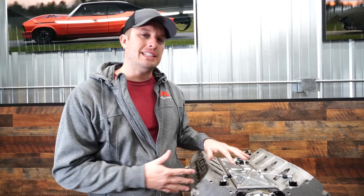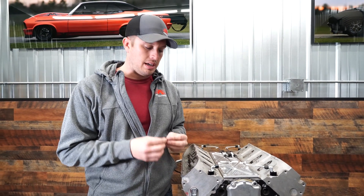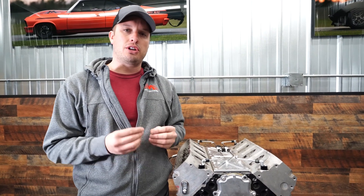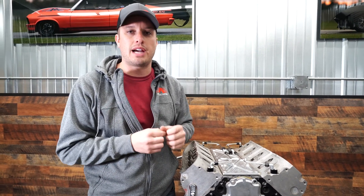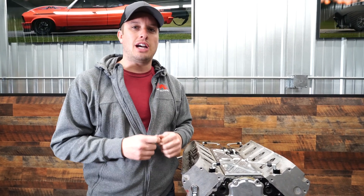After a year of making these, I've seen guys who didn't have them push them out on a very regular basis. There are videos all over the internet — you'll see the water dump, the car goes sideways and into the wall. Hopefully they save it; some do, some don't. But we get the call the next week — 'I wish I would have had those.' I would rather see you weld it, do it yourself, come up with your own mechanism. Just understand there's a lot of force behind there when you're pressurizing a cooling system — pounds per square inch on that plug can be incredible. Make sure you're overbuilding it so it'll sustain and hold in there. It isn't as easy as putting a thin strap over the top, because it will break or blow out. Thanks for tuning in — I hope this was beneficial and now you understand what those are, why they need to be addressed in a boosted or high-horsepower application, and hopefully it'll prevent you from having a similar issue.